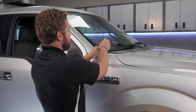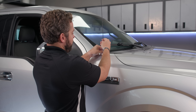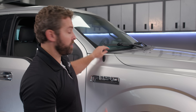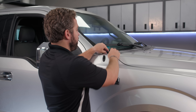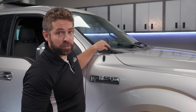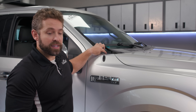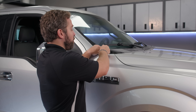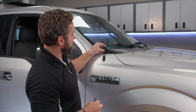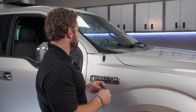Let's go ahead and remove this antenna just to get it out of the way — you don't have to do this, it just makes it a little easier. There's a plastic shielding here; you can just pull up on it and it'll pop loose just like that. There's a bolt located right here — we can use a size 10 socket to remove this bolt. Then our bracket we're going to set right in place here and reinstall that bolt.